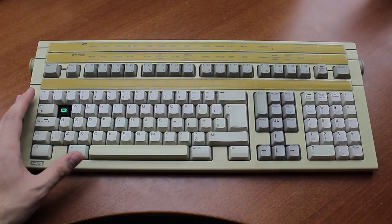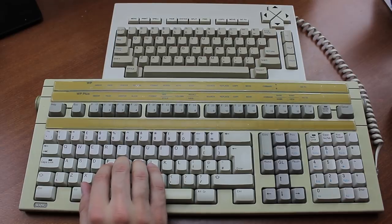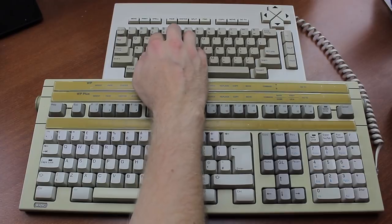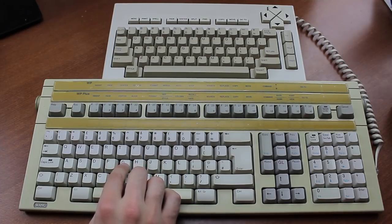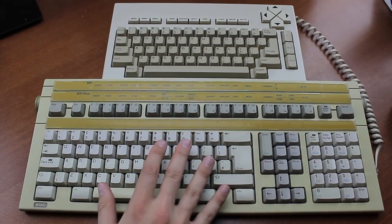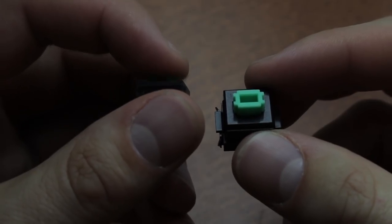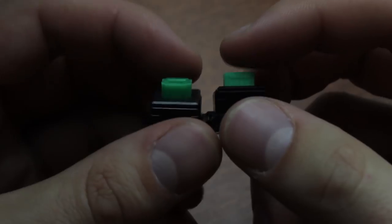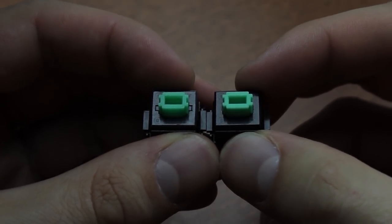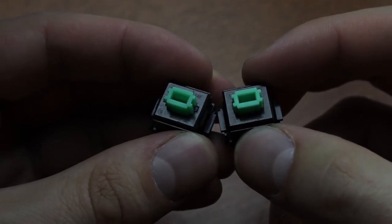A long time ago I did a video on a custom keyboard called Project L — a restored Wang 725 — which I decked out with new old stock neon green Alps of the bamboo variety. When comparing the neon greens to the brown ones, a few differences quickly pop out. First, the neon greens, although not light switches themselves, are noticeably less stiff than the brown switches. Second, the tactility on the neon greens is both less pronounced and more drawn out — they feel yet more rounded, almost a plateau-like feel. Of the three types, this is actually the most unique feeling. This difference appears to be a consequence of the bamboo redesign, because the earlier pine versions feel much more tactile and slightly stiffer, meaning they feel much closer to brown Alps. I admit I'm basing this on just a few loose switches, but I've conferred with someone who owns both the brown and pine neon green keyboard and they agreed with me.